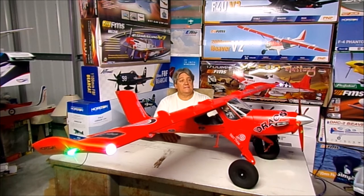They should have said, listen, if you're doing this, you don't want to do that with this plane. Or you want to at least bump the trim up on the throttle before you take off. I would bump it up till the motor starts running and either leave it there or click it one back so that it'll windmill when you come down, not brake. Okay? But that's the wrong way to land, so I'm not going to get too crazy into that.